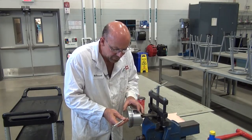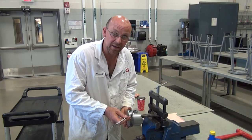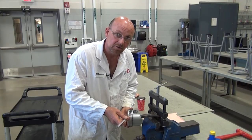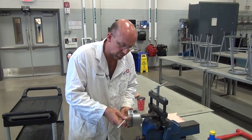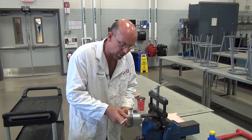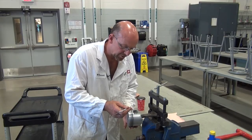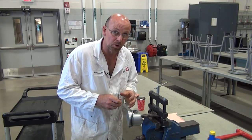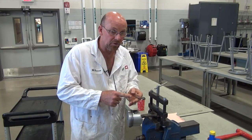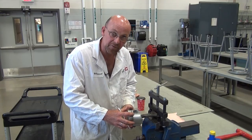The top ring is the compression ring — we call this the fire ring. The second ring backs up the fire ring to assist in compression, seal the cylinder and rings to the cylinder wall, and works in combination to scrape a little oil away from the scraper assembly. The oil scraper assembly is required to do most of the work: controlling the quality and quantity of oil and regulating how it brings oil on and off the cylinder wall based on the sharpness of that ring.